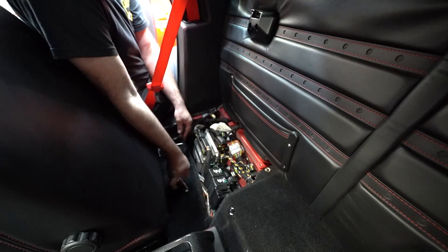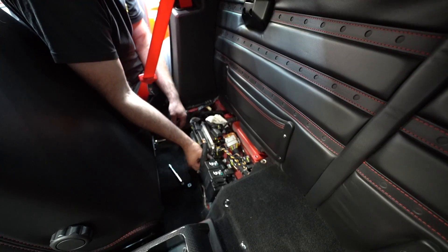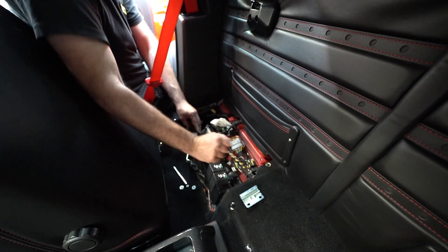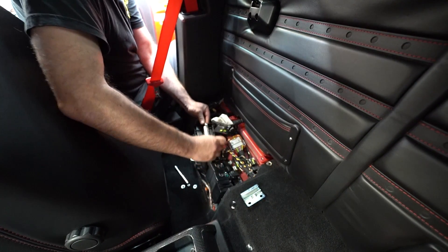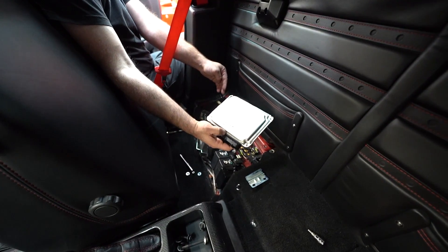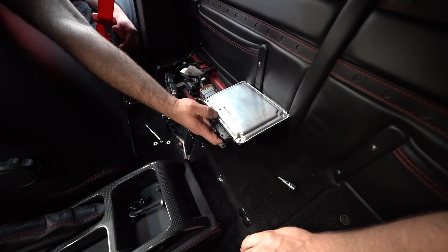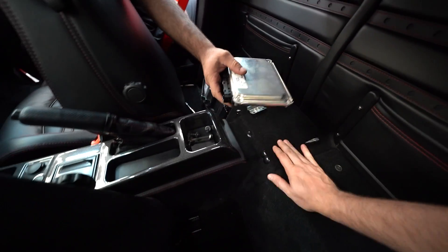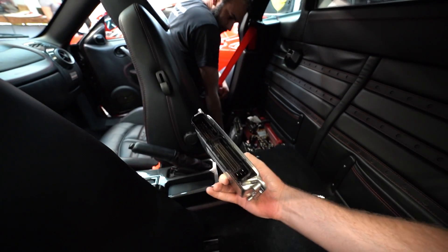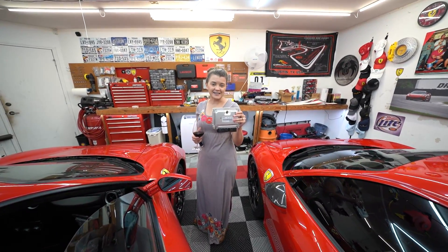Take the nylocks off a little more — there are a couple of washers under there. Don't lose those, because you'll end up with a mysterious rattle in your passenger compartment that you'll never understand. So it is just a little bracket — way easy. Label them as left and right. Actually, they're already labeled: DX is Italian for 'destro,' right-hand side; and SX is for 'sinistro,' left-hand side. There it is — the ECU.